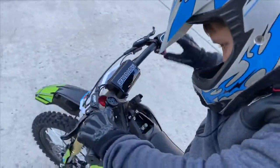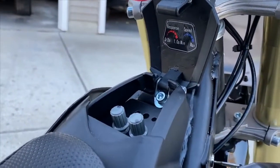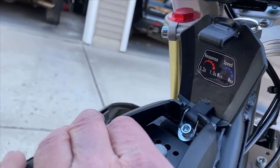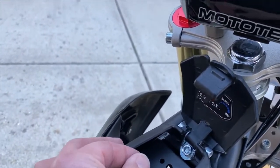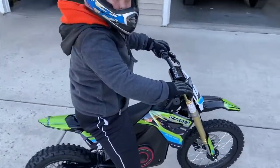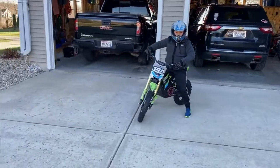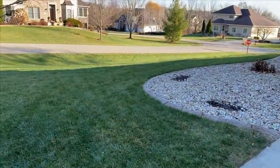So here, yeah, and then the other thing is we got the dials here for throttle response and speed. And I put little black dots on these so they kind of know which way they're turning, but this is the lower throttle response, 0.2 seconds, so it's quicker. And this is max speed. So do you notice much of a difference, Mikey, when you're doing those? I noticed that. Yep, so right out of the gate, get a little bit more of a lift up on the front. Yep. Why don't you go up that grass hill again and see if it shows anything more for juice going up.